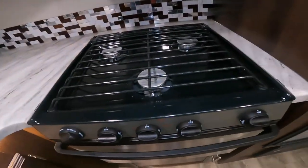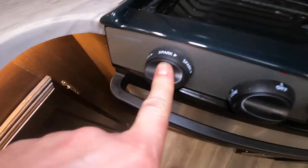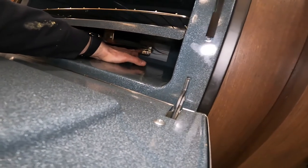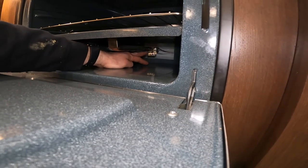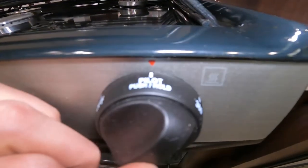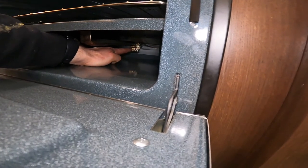We'll come over to your range top. The range top has an automatic sparker — you turn to the light position, turn the sparker, and it will light your burner. The same can be done for all three burners. The oven itself does not have an automatic spark, but you can see the pilot right back here. Whenever you're going to light this, put your barbecue lighter right here to light the pilot with this knob in the light position. You also have to press and hold this knob in to release the gas while igniting it with your lighter at the pilot.